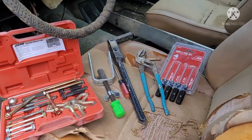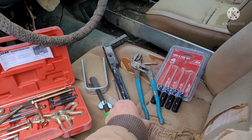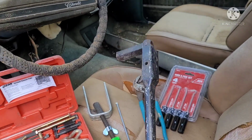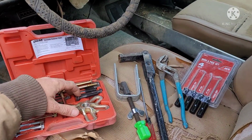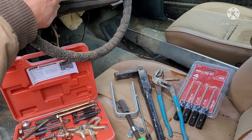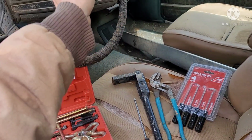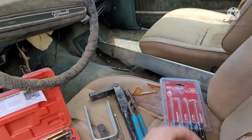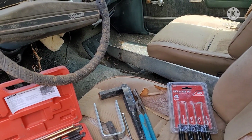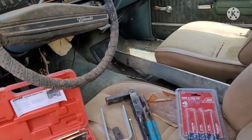So here's the setup. Phillips screw, take your horn pad off, 3/4 inch, mine happens to be a tire tool. Take your steering wheel nut off, set up your steering wheel puller, pop your steering wheel. Then you'll see the lock plate. Put your lock plate tool on, screw that down, pick the snap ring off with the hook, let that plate release, and then you're off and steering.